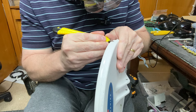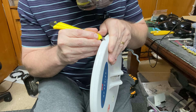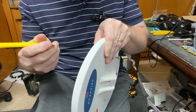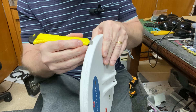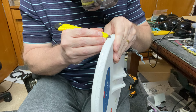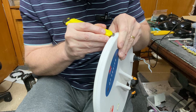All you've got to do is just break that seal and go around. Don't put your hand in front of the blade. If it gets stuck, don't push like crazy because the blade will go in and put slices through the top part — I've done that in the past, learned my lesson. I've already been around this very lightly and now it's gone in. Keep your blade flat — you don't want to bend it up or down. You want to keep it flat as you go around, pushing it with your thumb with good control.